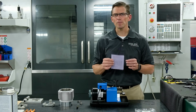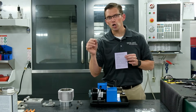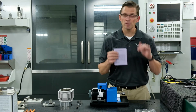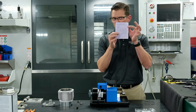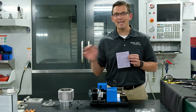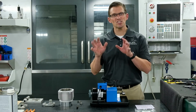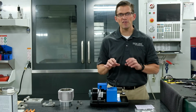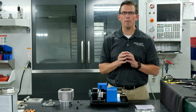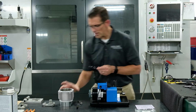As we mentioned before, a turbocharged engine under high boost is going to need a larger end gap than a gasoline engine that's naturally aspirated with no boost. So the chart gives you all the correct factors to determine the proper ring end gap. Once you've done that, you need to check your rings to see if they need to be filed to fit. Some sets will need to be opened up. Some sets are drop-in.